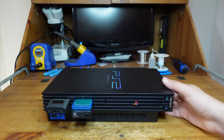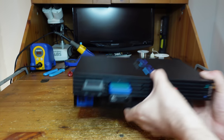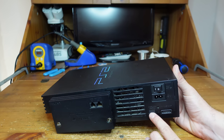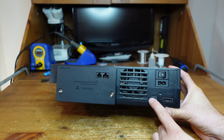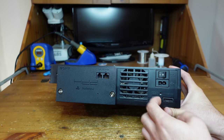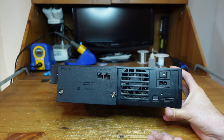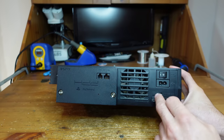Everything is finally fully assembled, and it just took me quite a while to get this thing buttoned up. I wasn't anticipating that, but it ended up being a couple of unexpected things I really wasn't expecting from reading the install documents. The thing I wasn't expecting is that I had to slightly enlarge the spot where the optical port used to be because this 3D printed mount really didn't quite fit - the mini HDMI was just ever so slightly too big for the original port. So I had to cut over here and also on the top to make everything fit. But it wasn't the end of the world - now everything fits perfectly and it actually looks really clean on the outside. I really love that Pixel FX installs look clean with either no-cut or very minor cutting.